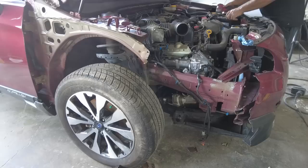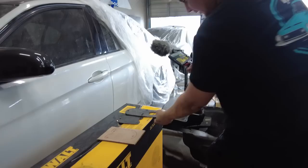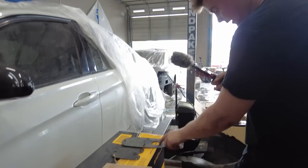And over here we got the big boss with another Subaru that I'm going to have to weld. Again, same spot, same deal, same car. The frame rail puller is all nice and done right here. You can see the first cut didn't have the actual hooking attachment, which is gonna get bolted on first, just like that, and then a hook can simply go in there and pull that frame rail perfectly down.